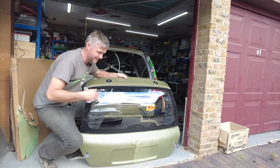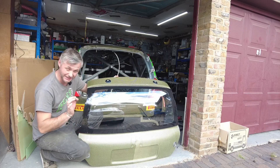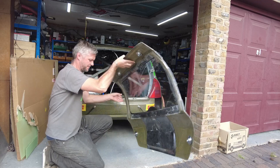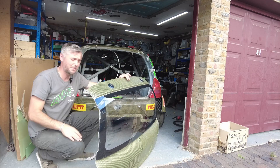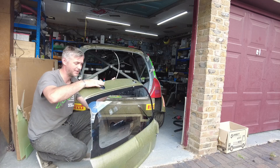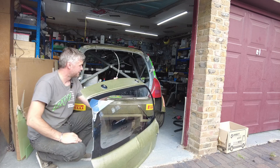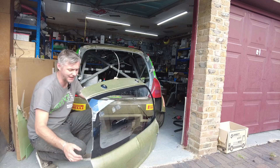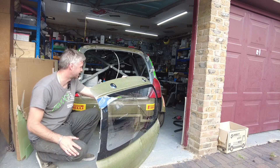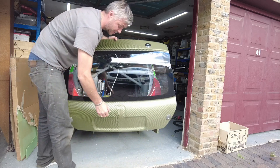Here we are — I present to you the Kevlar boot using a skinning method. It worked out almost better than I thought. It's super stiff. I want to say it's super light, but it's not super light — it's still four and a half kilograms. A lot of that is down to the glass, and maybe the fixing points which are probably another half a kilogram just for the hardware. But it's still lighter than the other one, and Kevlar completes the look. Sometimes it's just not 100% worth it — a lot of people might think Kevlar or carbon makes your car so light, but it doesn't really save you that much compared to steel. Let me show you how it attaches — locate one, locate two. Ta-da!